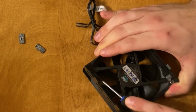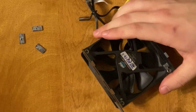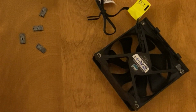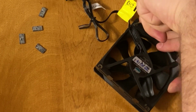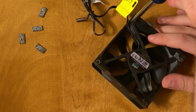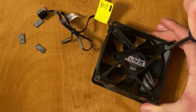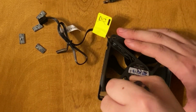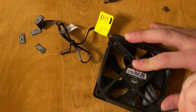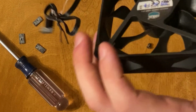It's really important that your airflow is going continuously throughout your machine, because you want the air to come in the front and out the back or through the top of the case like this case is designed. I find that it works a little bit better, and with this ASUS Prime Z390A board that we're using, it's really important that we have a constant airflow, because the fans are actually regulated by the motherboard, which is very cool. We're also going to be installing a Core i7 9th generation processor that has 3.6 gigahertz turbo to 4.9 gigahertz.